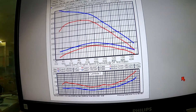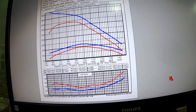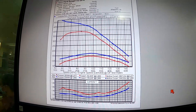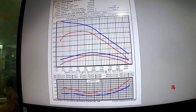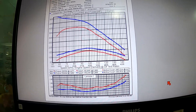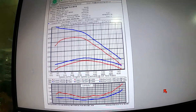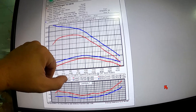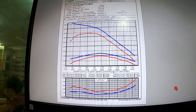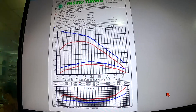So this is the result for the day. You can see on the graph it's got 152 wheel horsepower stock, and after the remap it's got 178 — roughly 26 wheel horsepower gained. Looking at the torque, originally it's got 393 Nm peak at 2400 RPM, and after the tune it's got 524 Nm at around 1600–1700 RPM, so the torque comes really early. That's an increase of around 131 Newton meters at the wheel.